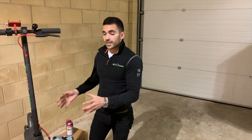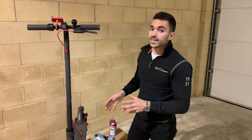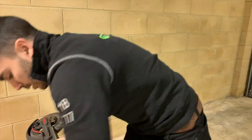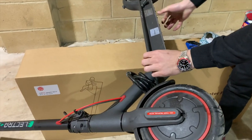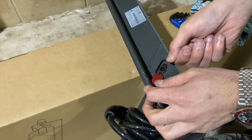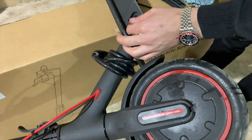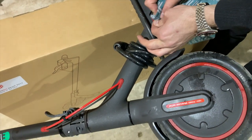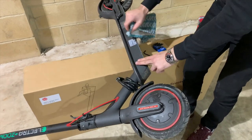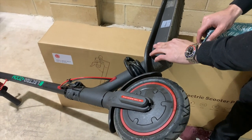That's pretty much the main things on the scooter from this side. You want to check the underneath as well and make sure everything's intact under there. Twisting the scooter over — we've got the charging port here. You want to make sure there's no dirt or grit housed inside. Every time you're plugging it in and out, you're pushing that dirt a bit further in, so give the charging port cover a bit of a widening clean. Make sure it's housed in correctly — the Pro's magnetic; the standard is a fitted finish that takes a bit more wedging to get in.